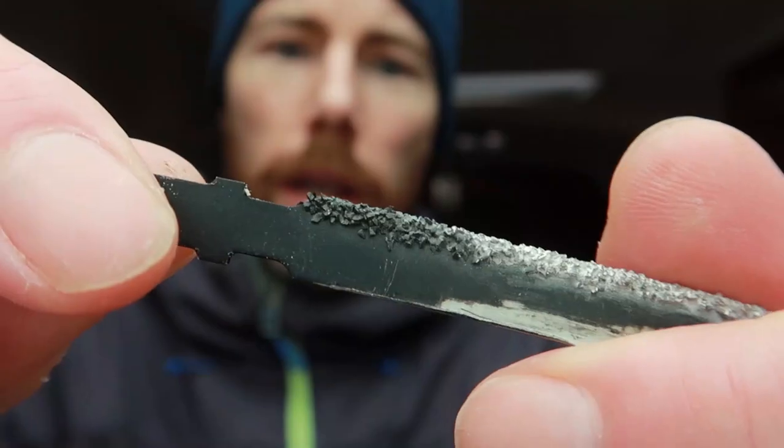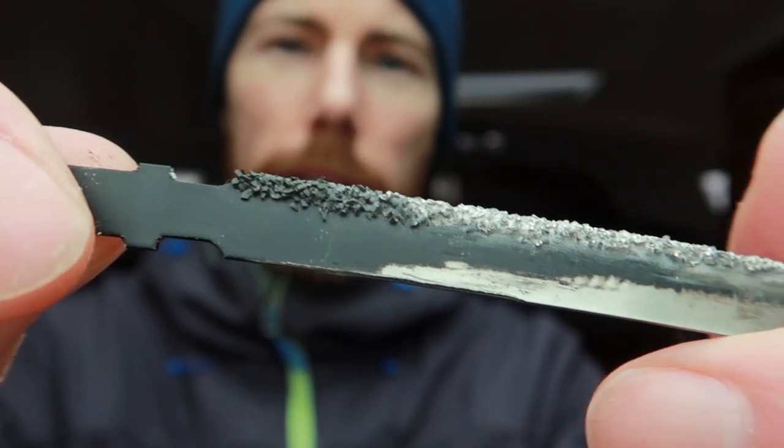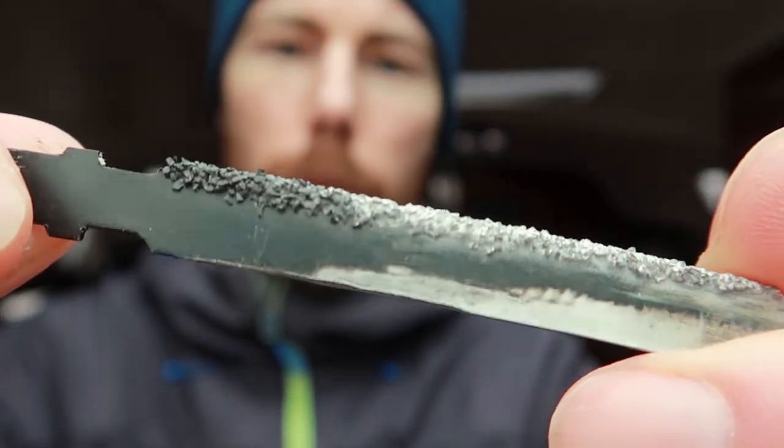For cutting I will use a traditional jigsaw, which should give a very nice cut. On my previous video on the hull I used a milling tool with a 4mm bit, and it created a lot of dust and the cut wasn't that nice. Because this is a sailboat we have quite a flat surface — it only has a slight curvature. So it should be easy to cut with a jigsaw. This cutting blade has a carbide tip, and I did some test runs on spare fiberglass and it works perfectly.